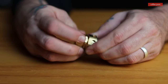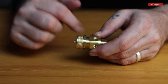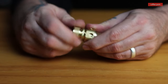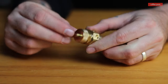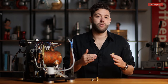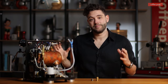Now the safety valve works a bit differently. The safety valve is there for exactly what the word says — safety. Basically, as the machine gets to pressure the anti-vacuum valve is now closed, and in a heat exchanger machine or with a PID controlling pressure, it cuts off the element as pressure rises, then turns the element back on as pressure drops. If the PID, pressure stat, or thermostat fails and the pressure keeps rising, you need something to stop the boiler from effectively becoming a bomb.